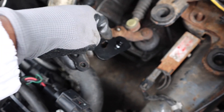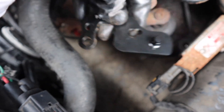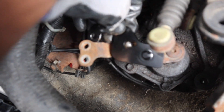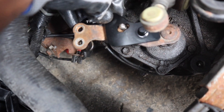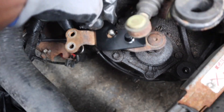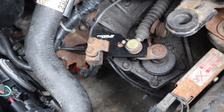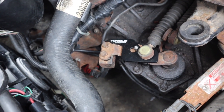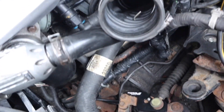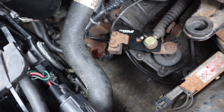To put this in, you're literally going to put this part right here — these two holes go under, then you put it down through the hole like that, snug it up, and then put everything back. And there we go guys, short shift plate is now installed. Let's go back inside the car and test it out. Just throwing everything back on the intake and we'll try this out. Super super easy install.